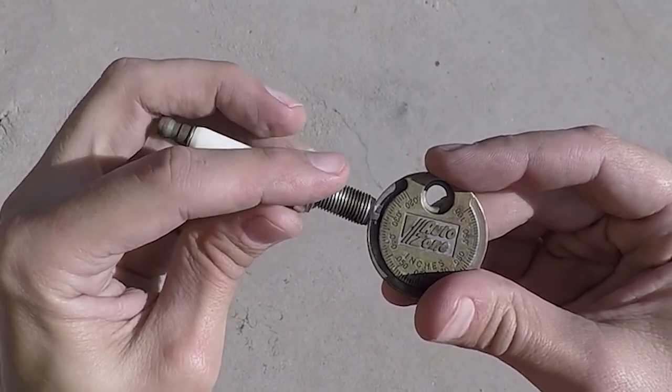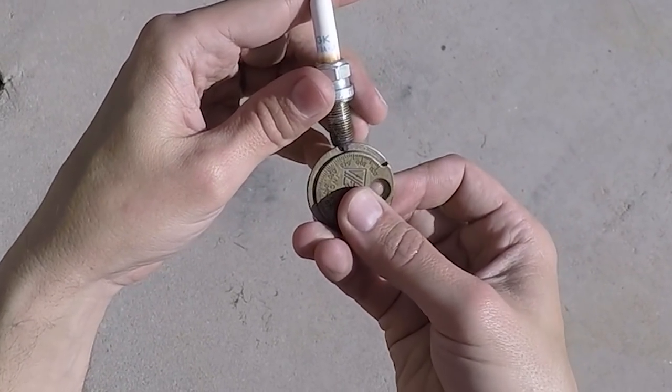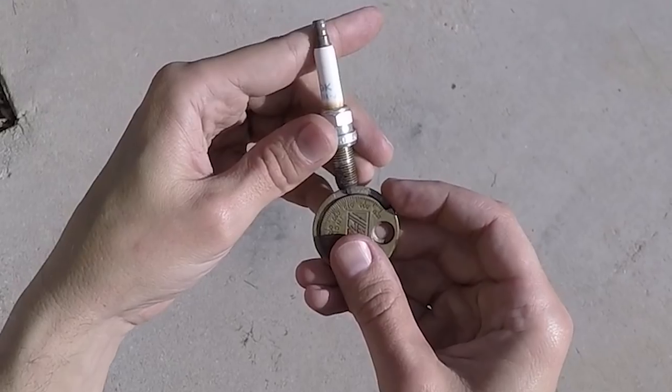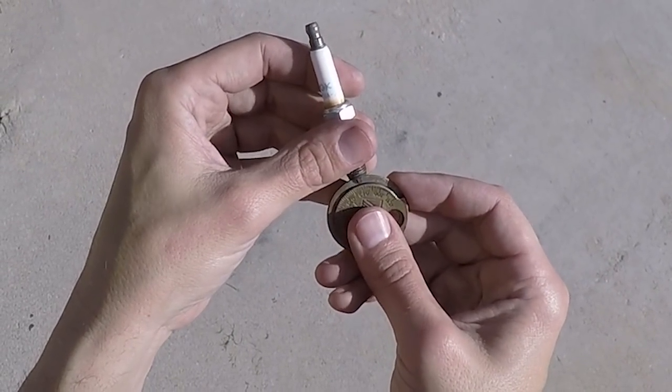Start at the thinnest spot. And we just rotate the dial here until we find our thickness. And so we are at 38 thousandths. It's actually closer to 40. Now the spec is 28 thou to 35 thou. So we're over about 5 thou on this plug.